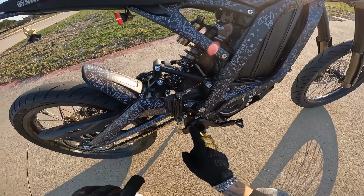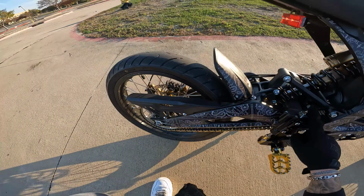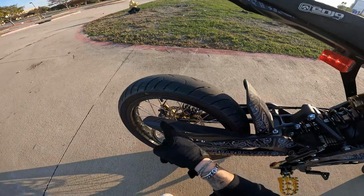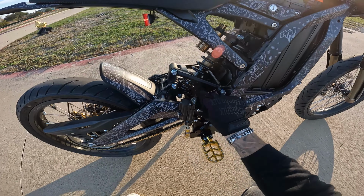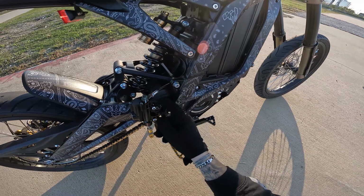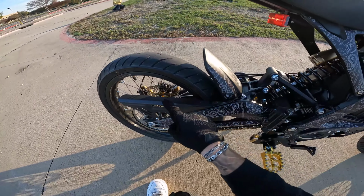So you do have to buy a brake line with all the fittings and everything, along with a DOT 4 or higher fluid caliper. I ended up going with the Hope brake line kit. You can go with a steel braided one. A lot of people do, and honestly it's better, but I just went with the normal one. It comes with all the fittings that you need.